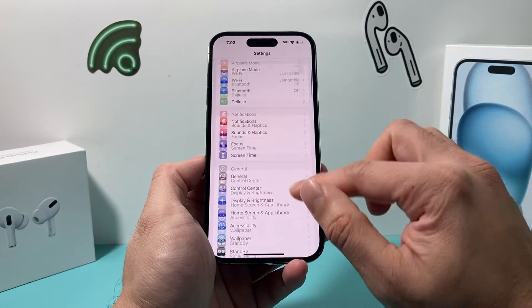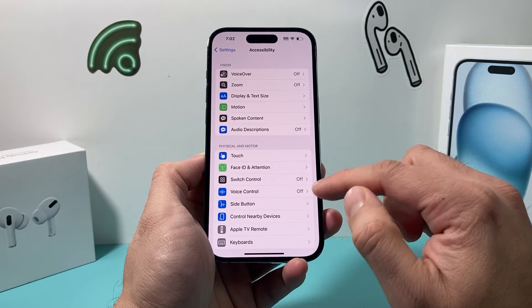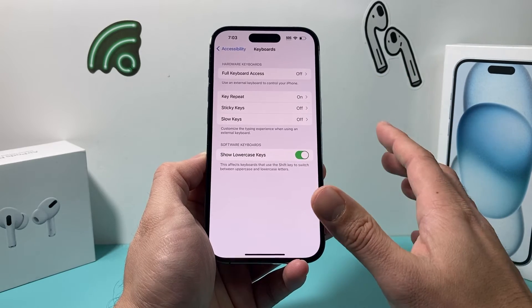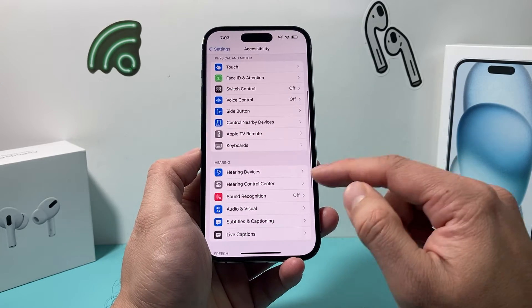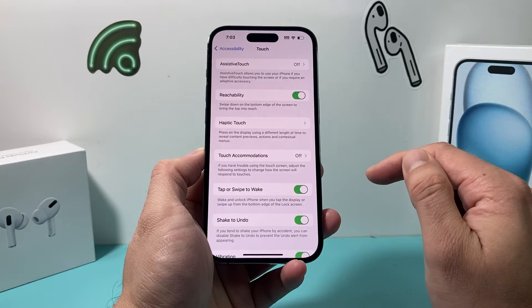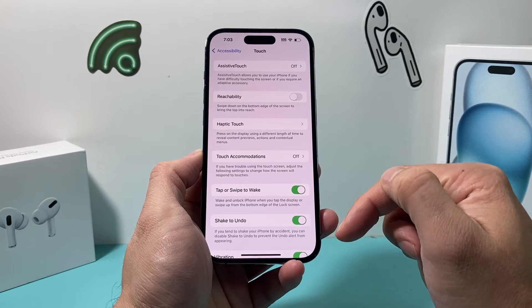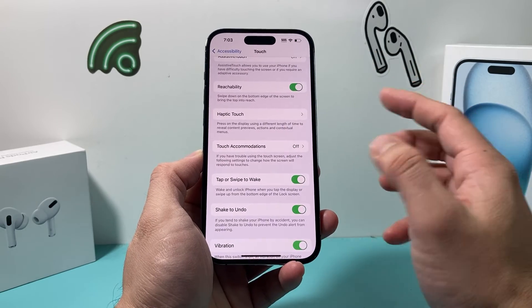After updating and if it's still not working, go to Settings and hop over to Accessibility. Under Accessibility, look at the options under Keyboard to make sure those settings didn't get messed up. Compare them to the defaults shown here. Also check under Touch — for Reachability, you may want to turn that off, as sometimes reachability can cause the keyboard to slide down and disappear when activated. Turn it off and see if that makes a difference; if not, you can turn it back on.